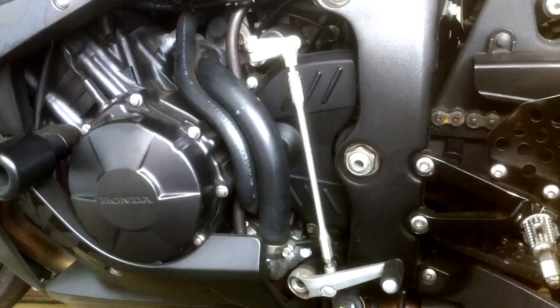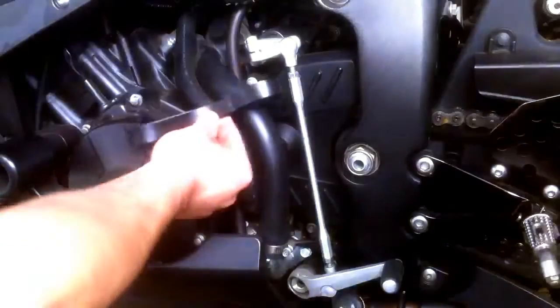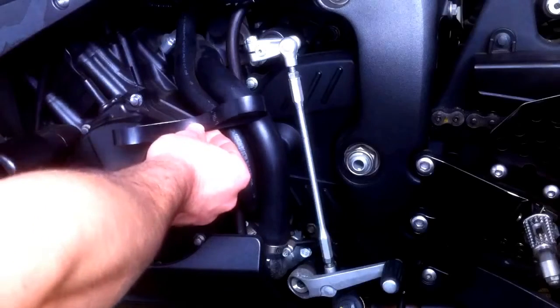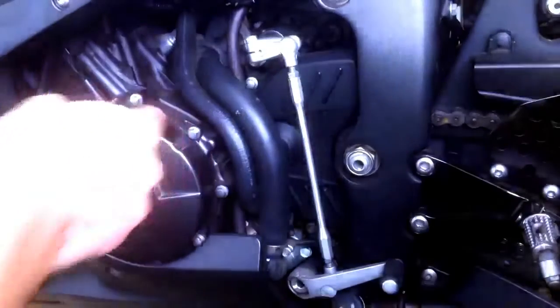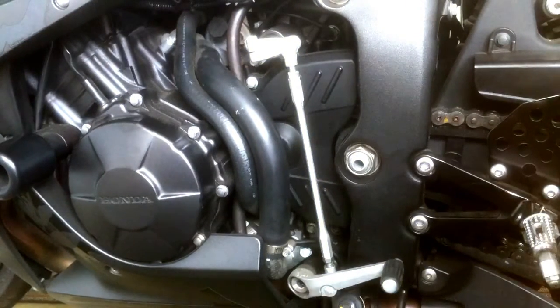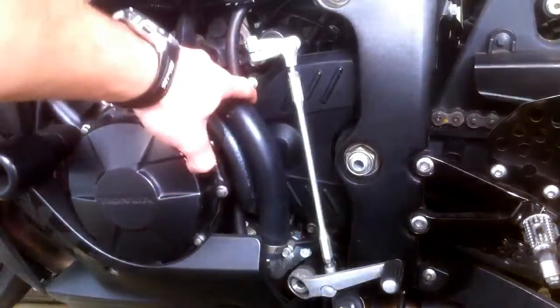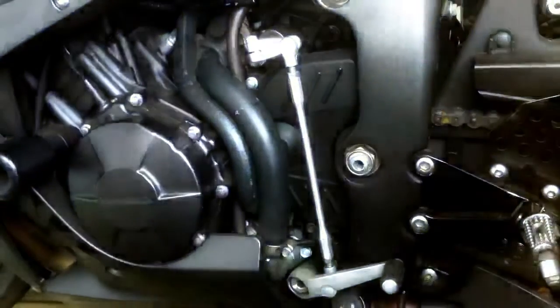What I'm going to do is take the radiator hoses off, and then put this right here so this pulls it back, and this doesn't reach all the way. So I'm going to put the zip tie around my chuck right there for my frame slider, and have this pull these back, because when you switch it over to GP shifting, the rod is actually touching the hoses. Another idea somebody gave me was to just use all zip ties, because that's all they had, but it's going to be too abrasive on the hose, so it could cut it later on. So they put some fish tank or rubber hosing around the zip ties, so that way it wouldn't cut through it.